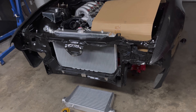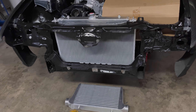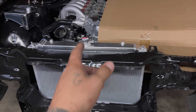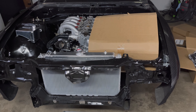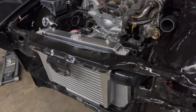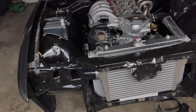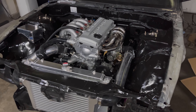It's time to do the intercooler. Traditionally we put them in the front mounted to the support, but this one I'm gonna do a tucked intercooler — literally put it up tucked in there, cut out that spot, and the intercooler piping is going to go directly to it. It should spool even faster since it's such a shorter run from the throttle body to the turbo. The intercooler is going to sit in the front just like that, utilizing the stock bumper support. Hot side is pretty much complete, just gotta work on the cold side — that's going to be a pain because I have to incorporate the MAF.